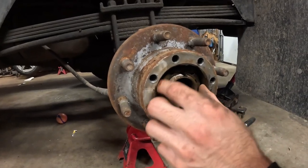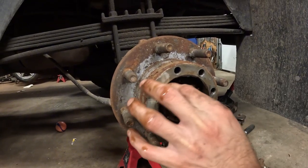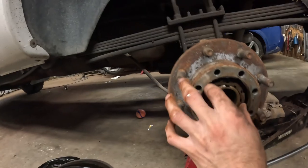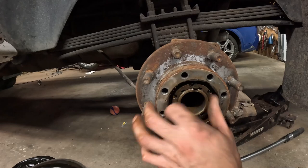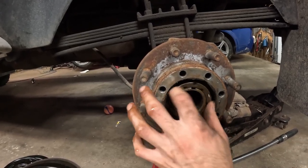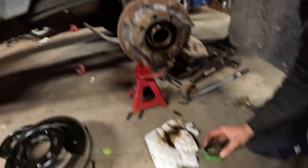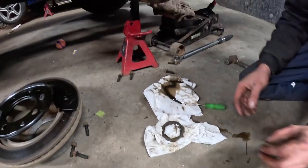And then after that, wow, it's just hand tight. That was a little loose actually. You don't want any play in that, really. There's a special socket you can get for this. It's supposed to be 20 foot-pounds when you put it back on, but you can just kind of guess it with a pair of pliers. Do a better job than that, anyways. Yeah, that wasn't 20 pounds.